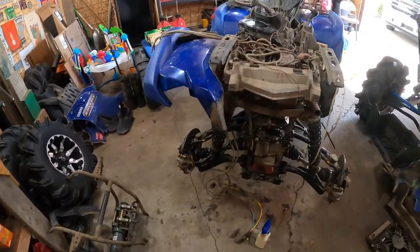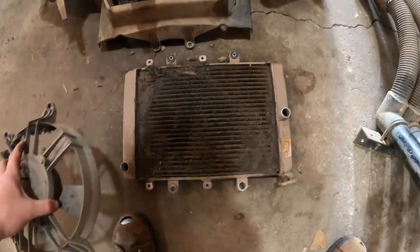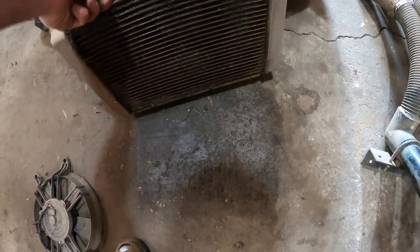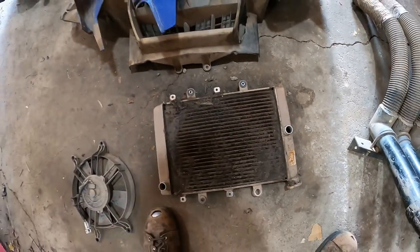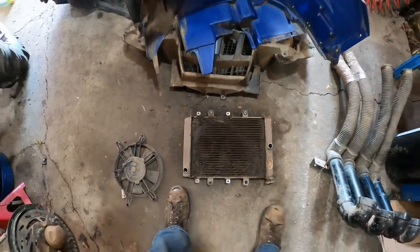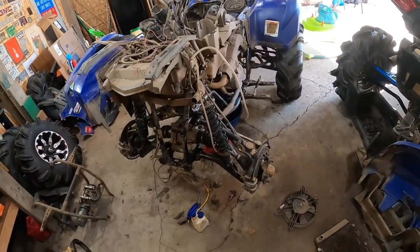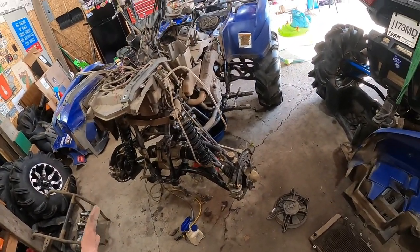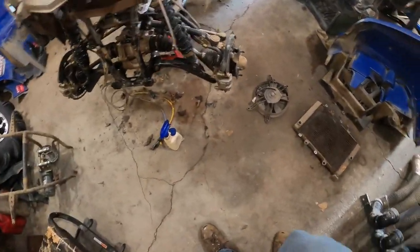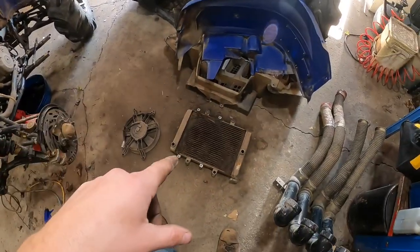So I started up and I want the rings to be moist, especially after swamping a couple times five or six years ago. The radiator — it's time for a new one. Here's what it looked like when I pulled it. It's just caked. It's hard to clean the back side of radiators in Grizzlies, the front's also hard. I got it a little hot at Tiger Tin last weekend.